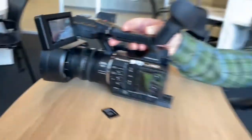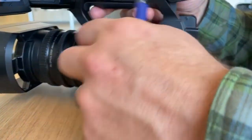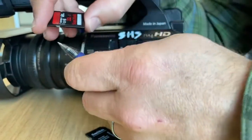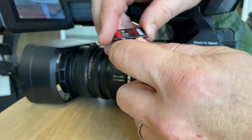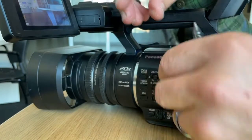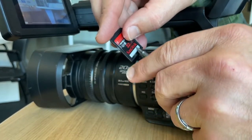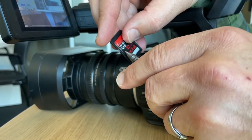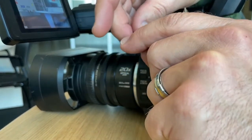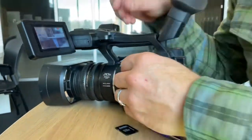Now, if you find that the card is full or it says 'unable to write,' the first thing to check is to punch the card back out and make sure that the write-protect slider is up. If the write-protect slider is down — which happens because when we push the card in it can catch — it protects anyone from writing more information to the card or reformatting it. So make sure that the write-protect is unlocked and up, then put the card back in.